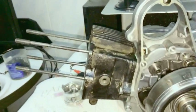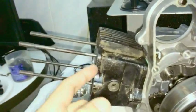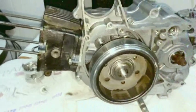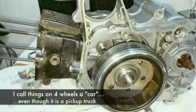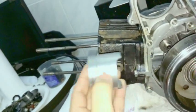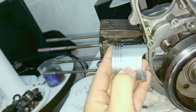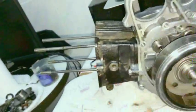And because the piston's going really slow, it's not wearing out nearly as fast, and it's not traveling nearly as far. So effectively, this engine spinning at 4,000 RPMs is pretty much like my car spinning around 2,000 and change, because it's a slow piston speed because the stroke is so small, and so the distance traveled is so small per rotation, whereas this piston, the long stroke, has to go much faster just to go that same amount